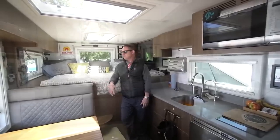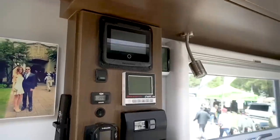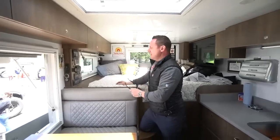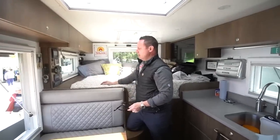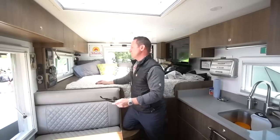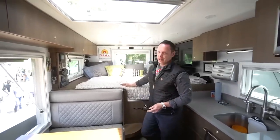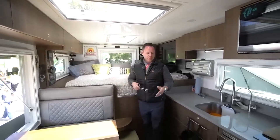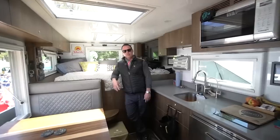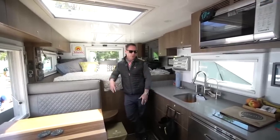Right now it's a bright sunny day in Flagstaff, and my battery bank is at 85%. Three hours ago I woke up and it was at 68%, so in the course of a couple hours I've renewed my battery bank by almost 25%. I'm bringing in 59.8 amps of solar right now. My fridge runs off five amps, and my air conditioning at full blast is running on 40 amps. The air conditioner is under-bunk — it's the Cruise and Comfort, a solid system built for the marine world.